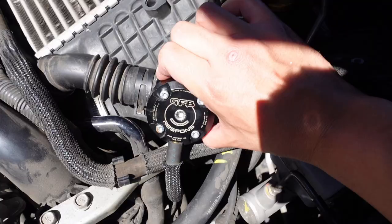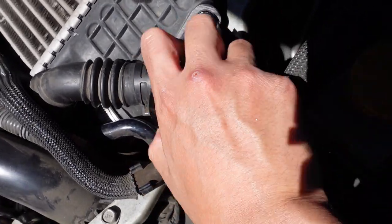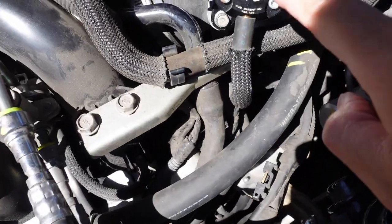All I had to do was turn this thing right here, which closes off this opening — meaning it's fully recirculating. If you go the other way, it's fully atmosphere. That's what was causing the fuel trims to be skewed and the reason for the pops. There are also preload settings, but I'm going to leave that alone for now. A lot of people get these blow-off valves for the cool sounds, but I'd rather have the car running healthy. Since it's fully recirculating just like the OEM one, my guess is it'll hold boost a little better — I'm pushing 18 pounds of boost, so hopefully this aftermarket BOV handles that better than the factory one.